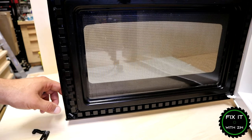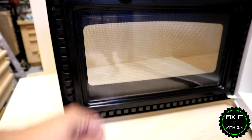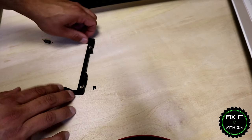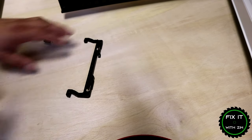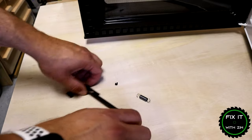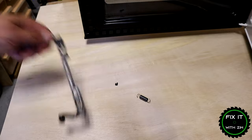Looking down here in the bottom of the door you can see all of our broken pieces. Here's the spring — that's what keeps tension on the latch. And here's our culprit that is causing our issue. The way all this is assembled is the latch sits on the door, and this little piece that's broken off sits on the latch like that. Our spring gets attached to that, and the lower part of the spring gets attached inside the door. Obviously when this piece breaks off, the spring no longer performs its intended function, and the latch doesn't sit down tight to keep the door closed.